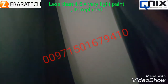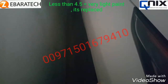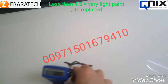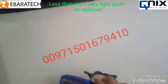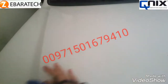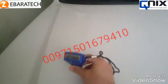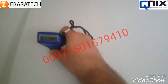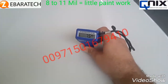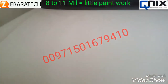Seven — we check the exact same point on the right fender and the left fender, both showing the same. Here the paint is showing seven-point-five. This is a good point to check because this is a curve, so they may apply a little more material. On the other side it's also seven-point-five — one hundred percent symmetrical.